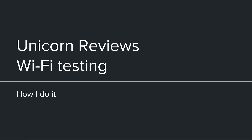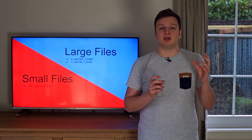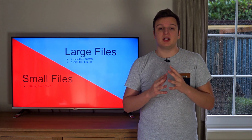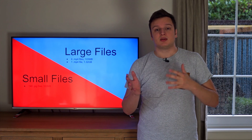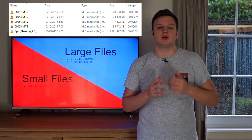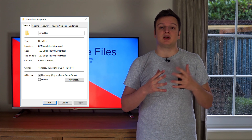In this video I'm going to explain to you guys how I do the Wi-Fi testing in my reviews. In the blue camp we have the large file folder — it's one folder that I copy from an SSD server to an SSD client over Wi-Fi. The server is connected to the access points or the router that I'm testing, wired with a gigabit connection, and then there's just a Wi-Fi connection between the router and my Surface Pro 3. The large files folder contains four smaller MP4 files and one large 4K video, like the one you're watching right now, to test realistic 4K streaming and file transfers.